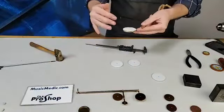When you say good feel, what do you mean? When you kind of press it in, you don't have to really force it in there. It kind of wants to just ease in. But with a little bit of resistance? Just a little bit of resistance. You can see it'll hold it. There's your test. You put the pad in, you tap on the back of it, and the pad doesn't fall out. Doesn't fall out, and it's flat.